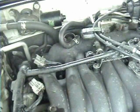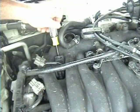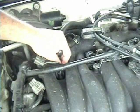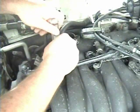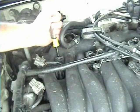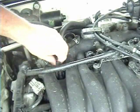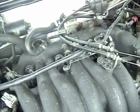What I do is just take the bolt, stick it back in the coil pack, stick this down here. Also, a screwdriver works, but if they're tight and you don't have the right size or the right tip screwdriver, you will strip them out. So, just put the bolts back in, tighten them down. Well, really, you don't even need to have bolts in there. Coil packs stay on the plugs pretty well by themselves. I've never had an issue with that. And obviously, you want to plug it back in. Not saying you shouldn't. Not saying you should not use bolts, but yeah.